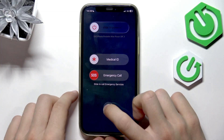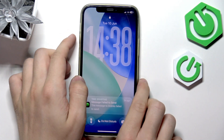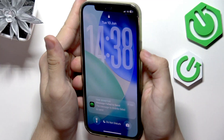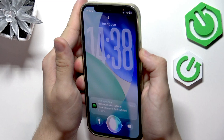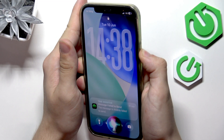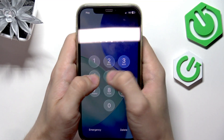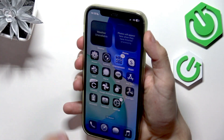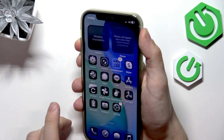...for example if nothing shows up on the screen or your device doesn't react to touch input, press first on volume up shortly, then volume down shortly, and then start pressing and holding on the power button until the display goes off. I think I failed because I was taking too much time. I'm going to unlock it because it works in my case, but you don't have to unlock it — you can just press volume up, volume down, then press and hold on the power key.